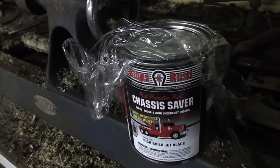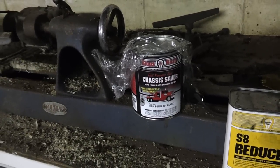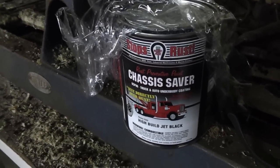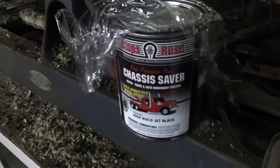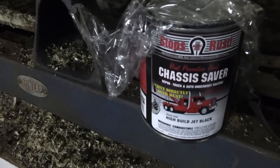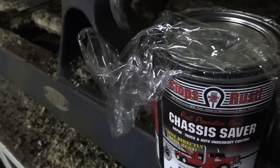I'm not going to clear coat it or put anything on top of it. In fact, this is not okay to be out in the sun — it's UV sensitive, big time. Apparently it will start chalking up and discoloring; right now it's a gloss black and it will supposedly change to like a charcoal gray if it's being beat on by the sun. But this is not going to be outside like a car — this is going to be an indoor display. So I figured it would be a good paint to try because it's very durable. You can smack it around with a hammer, and I haven't seen it chip on the samples I've seen. Most people brush it on and still use reducer as far as I understand. I sprayed — I think I'm one of the very few that have opted to spray this stuff.